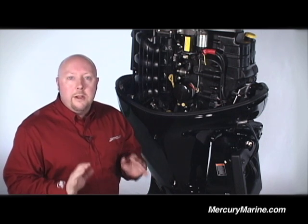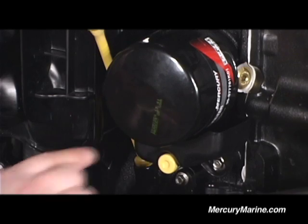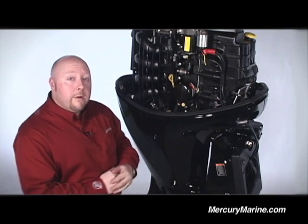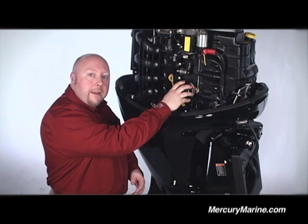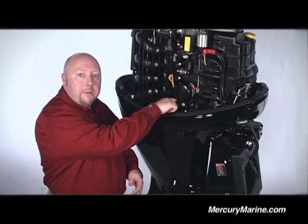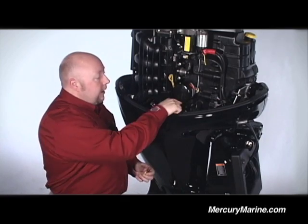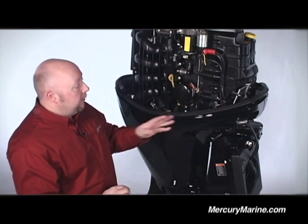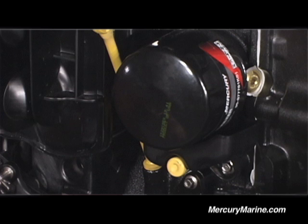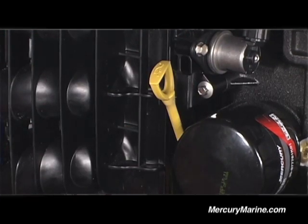One of the things we hear most is people don't like to change the oil on their four-stroke outboards because it always creates a mess — it runs down the side of the engine, and when you take the filter off it runs through the pan with a lot of cleanup work. We've eliminated that with this system. This is our new no-spill oil filter change system, and nobody else offers this but Mercury. There's a new little oil drip pan here so that any residual oil left in the oil filter when you loosen and remove it, rather than running into the lower pan of your engine, will just gather in this little drip tray. Before you remove the filter and after you've drained the oil, you remove this little yellow cap at the bottom, connect a length of hose, and let the oil drain out into the oil pan. Quick and easy, no spilling and no mess. After the oil is drained, take the hose off, put the cap back in, and wipe out the pan. Right next to the oil filter is the dipstick, also coated in yellow. We recommend you check your oil each and every time you go out, just to make sure you've got the right amount in.